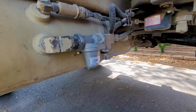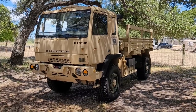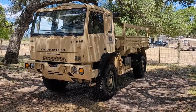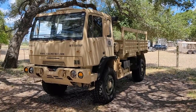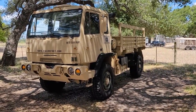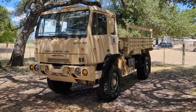I'll splice in a video of the crazy noise I was getting when filling the tires. Another thing I noticed with that new valve is as you're filling up the tires from a really low pressure, the radiator fan and the cab air suspension aren't affected — I think it's because that valve doesn't end up closing, so they don't deflate and that doesn't cause the fan to engage. With the other valve, as it was filling, because everything needed to work so hard, the radiator fan would end up kicking in and the cab would keep deflating and inflating. It's just nice that that doesn't happen. That was a good fix, and if it ends up failing I'll note it in a future update.